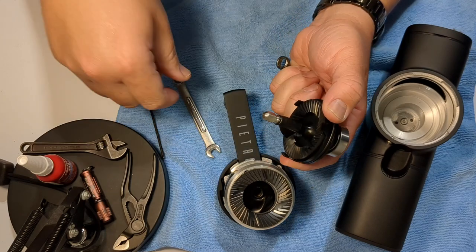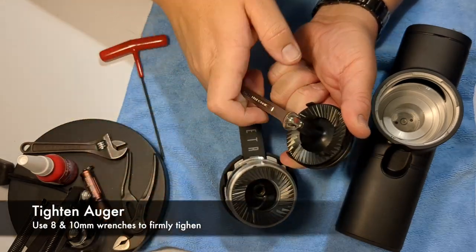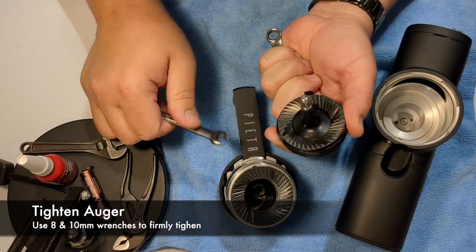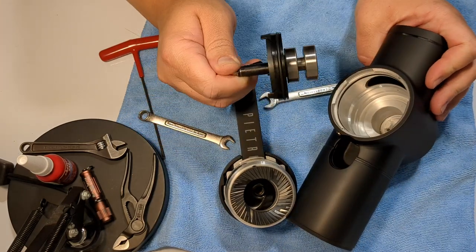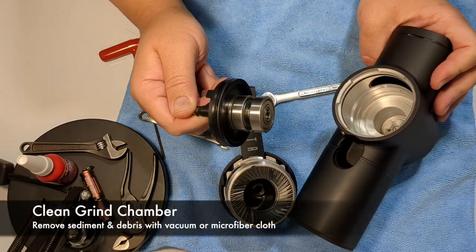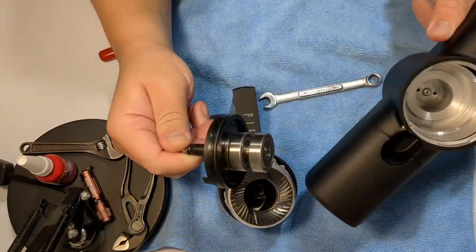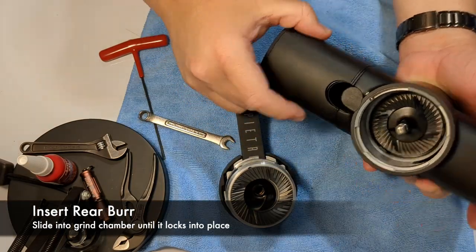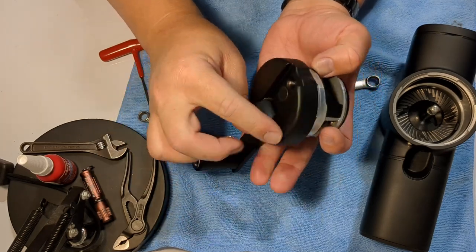Line the auger back up with the center hole, put that in, and tighten it down. Hold on to the 10mm wrench on the back, grab your 8mm wrench for the front, and give it a turn. When it's tight it stops — it doesn't need to be super tight. Now you can clean up the grind chamber while you have it apart — give it a quick vacuum and make sure there's no debris in the bearing area. Then the rear burr carrier slides right back in where it came from.